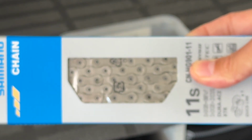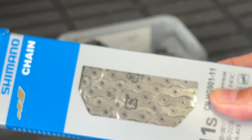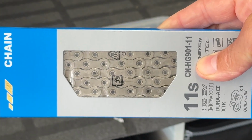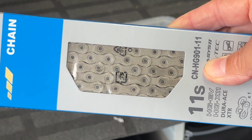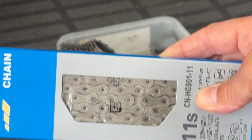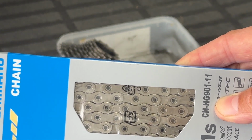I've got a new chain, and I have my super informative cycle expert in London, who's told me that I need to actually clean, degrease this chain first with, again, white spirit, then meth spirit, and then oil it. So to do things totally professionally, the recommendation is white spirit, then meth spirit. Then after that's done, you put the lubrication of your choice onto the chain, because apparently it comes with shipping grease and not grease for the road. So the best practice is to do all that malarkey.